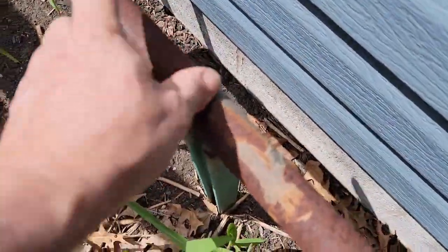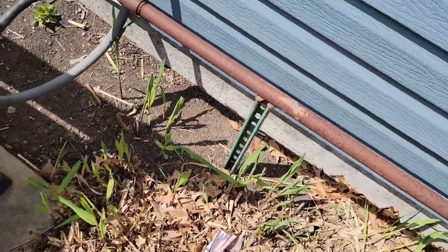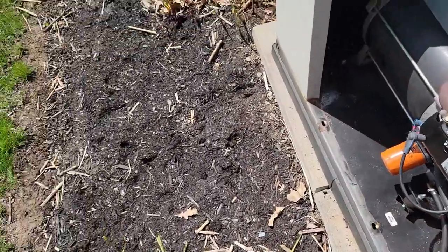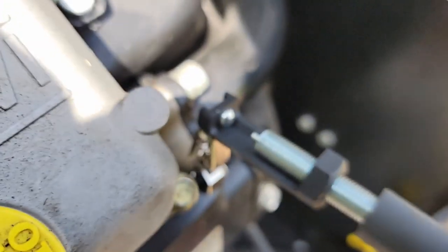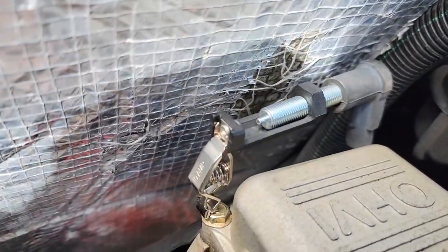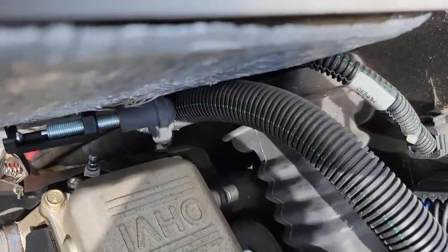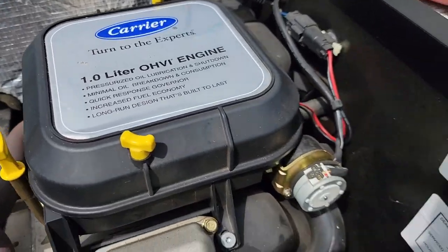That's quite interesting - they siliconed it on there. That's some strong silicone, that's why I would do it. I might even use a wire tie because those work really good too. Got it about the 12,000 mark, I think that's about where they said - I can't remember without looking it up. Let's take a peek and see if it got an arc. Okay, so we have a spark there - that one's working fine. Let's see the other one. We'll see if we can block the sun and get a spark. Yeah, it didn't work so well for the camera, but we felt the spark just fine.